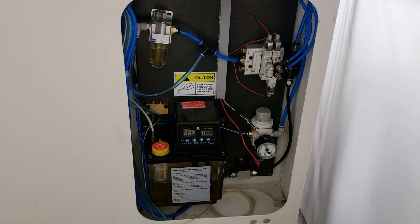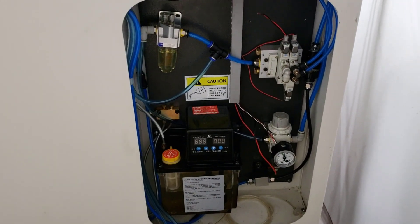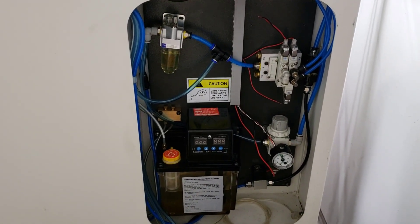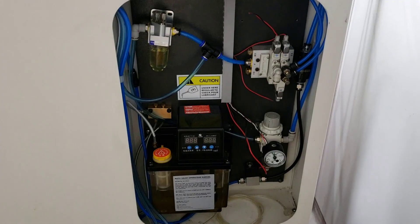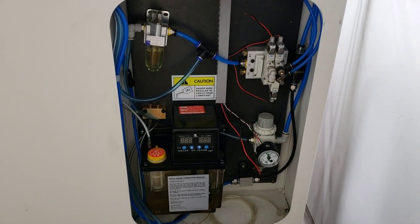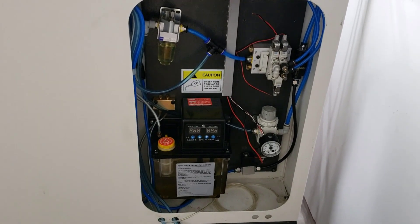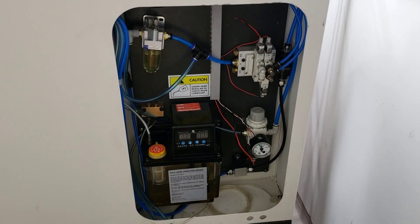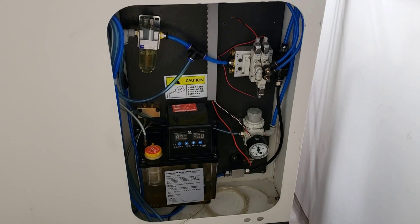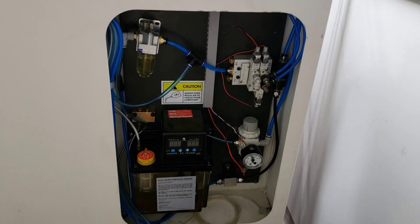So that's what I did. If you have a Skyfire, you might want to consider doing something similar. The links are in the description. It took me probably two hours to think it out and about three orders because I ordered the wrong things a couple of times — I thought it was all quarter, then three-eighths, but it's actually all five-sixteenths. So if you're going through this process, save yourself some money and time: it's five-sixteenths. Links to all the parts will be available. This was not expensive — I would suggest going ahead and doing this. I think this is a better way to route everything, unless somebody has an even better way. If you have a Skyfire SVM2 and an ATC, I would suggest looking at this mod. If you have another machine where the ATC runs off of air, it might be worth considering as well. Best of luck everybody, thanks for your time, bye.